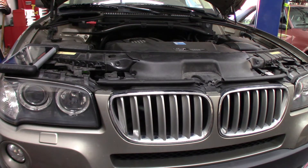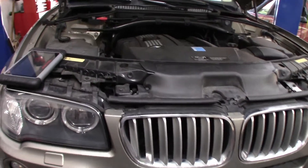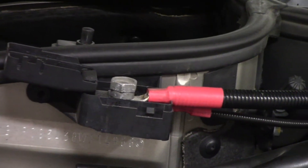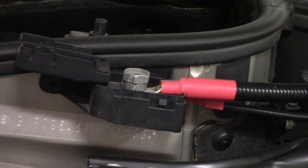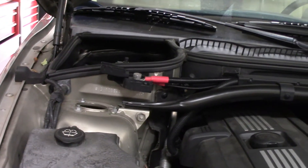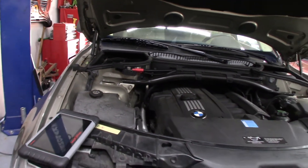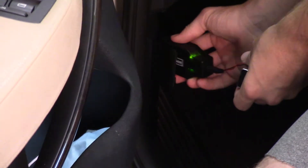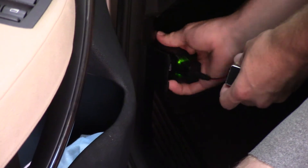It's a good idea to disconnect the battery. On these cars the battery is in the back, but you can disconnect the hot cable right up front — that's also how you jump it. Once that's disconnected you're golden. When you go to connect the memory saver, hook it up to the OBD outlet — it's right underneath the dash on this car. You can see it's powered now because we've got the battery hooked up to it. Just plug it in and leave it while you're working.